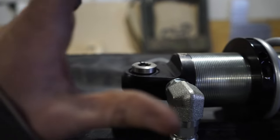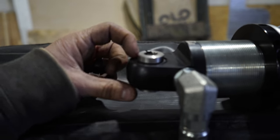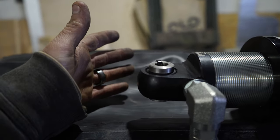We're working with very tight clearances. So we're gonna have to go ahead and take a cutting wheel to that hood support. I'm not afraid of making the hood flimsy or anything. It's literally just a few inches on each side that we're gonna be taking out of that hood support. And if we terminate it correctly, it shouldn't be a problem.